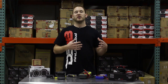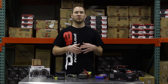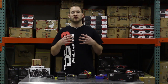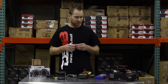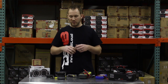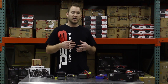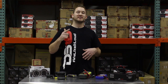If you have an aftermarket radio, in most cases the voltage output is high enough that you never need to touch the bass boost. Unless you can't get the system to perform how you think it should just using the gain, I wouldn't touch the bass boost. Sorry for such a long video — I wanted to make sure I touched base on all this, as these are very frequently asked questions. I hope you enjoyed the video and maybe learned a little bit. Thanks for tuning in and see you next time.